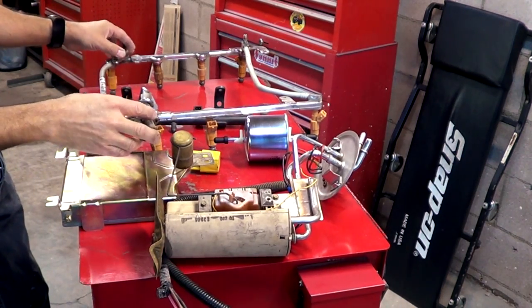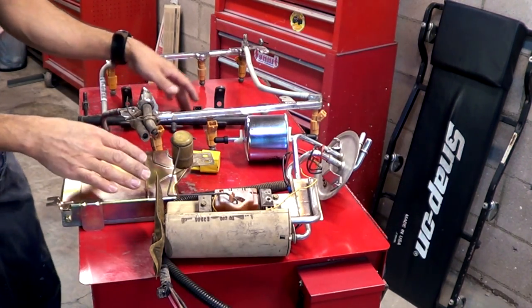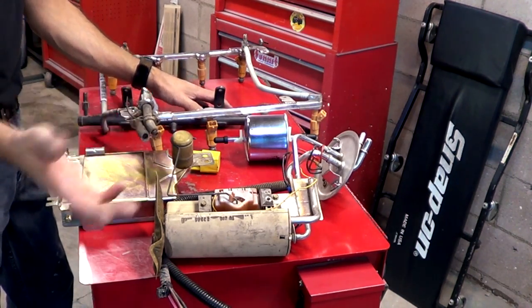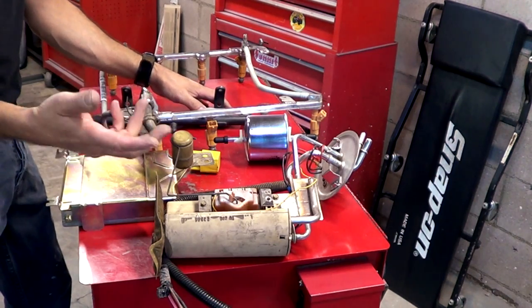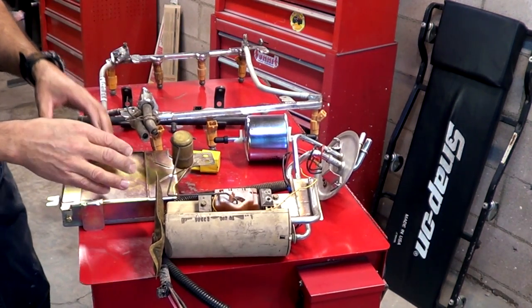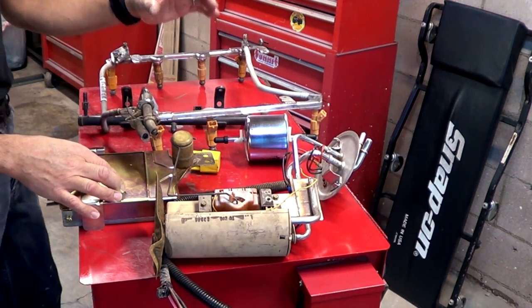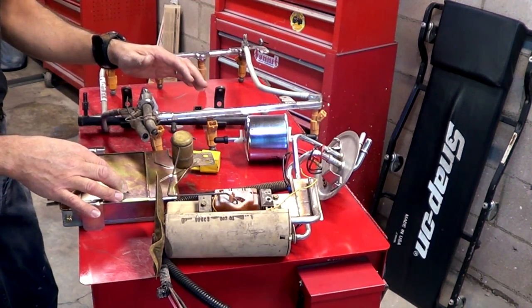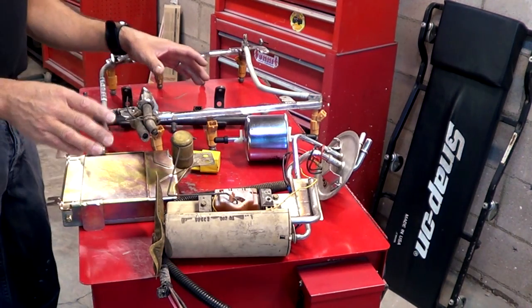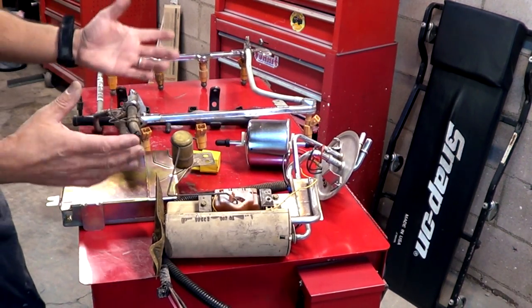Now for troubleshooting. We're focusing on the delivery part of the fuel system — not the sensors like throttle position, MAP sensor, or oxygen sensors that enable the computer to modify injector pulse width for different driving conditions. We're focusing on the mechanical part of the fuel injection system. One of the things that would make a fuel injection system not work correctly is lack of pressure.